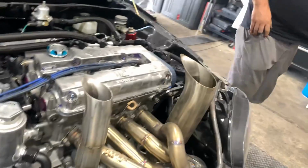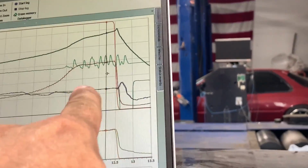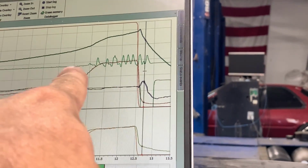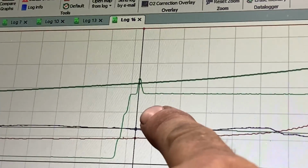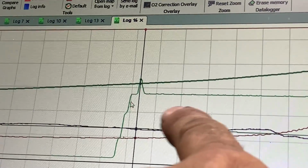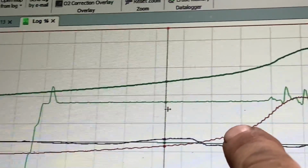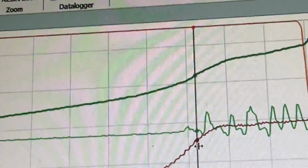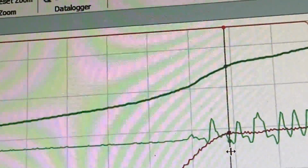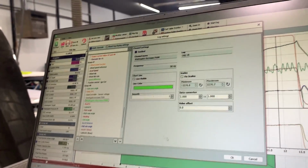Sensor is mounted on the gate. So what we're looking at right now is the wastegate, the CO2, the pressure. Dome pressure. Yeah, the dome pressure. Gate pressure is 30, and the target's 25 right there. So then it pulls it back down to 24.9. So it's 25, and it goes up, down, up, down, up, down. So you see the increase and decrease.